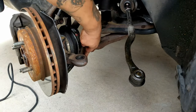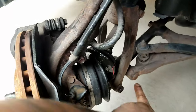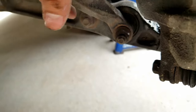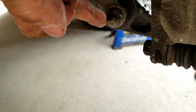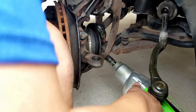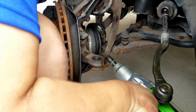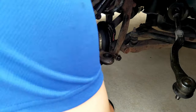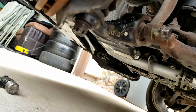Next I'll be moving this bolt right here and another one on this side — that's a 17 as well. Using an impact or torque wrench. Last but not least for the lower portion, this is the lower ball joint castle nut — same thing, cotter pin removal.